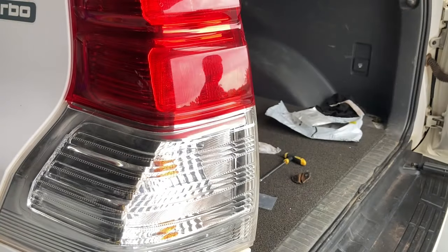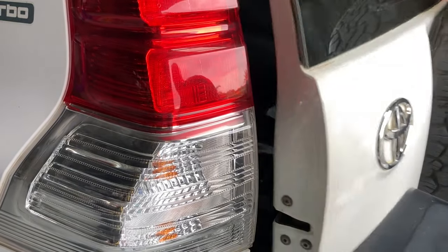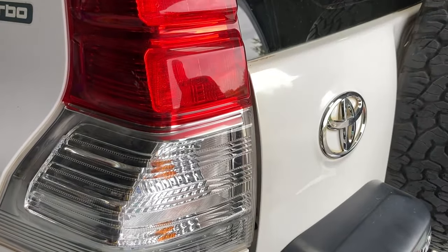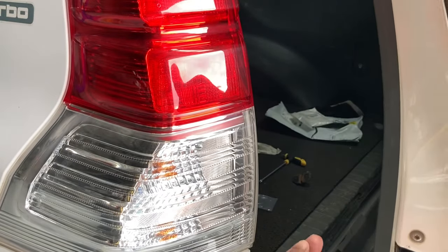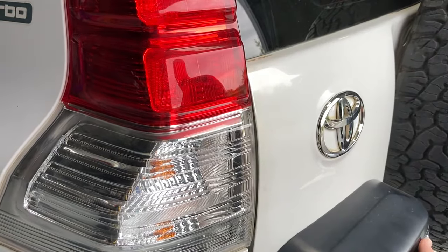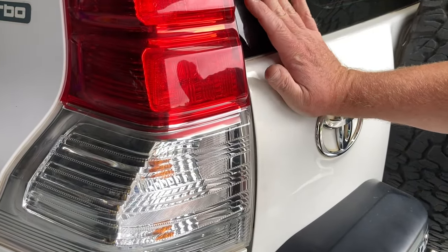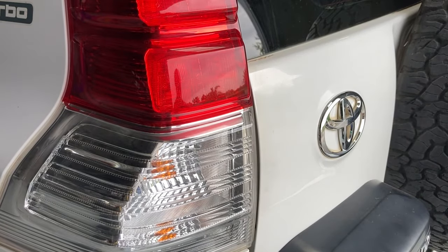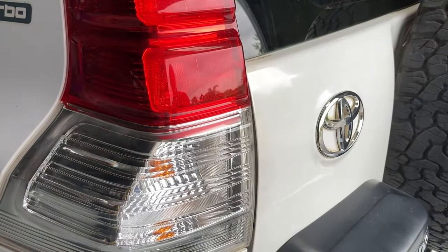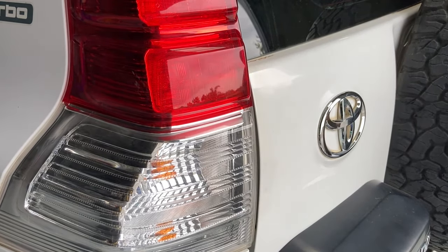Come up pretty good considering. The test will obviously be driving the vehicle, but I'll just shut the door for you now. Does that look any different? It's a bit harder to shut. If I go soft because I've got it right on the edge of adjustment, it's not quite — but if I give it a firm push, it shuts all the way. I can make it move but there's less movement — I've got to push harder. I believe this is going to be an improvement from a really rattly rear door. The top of the door still looks like it needs more pressure.